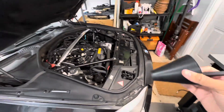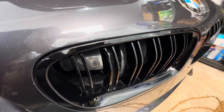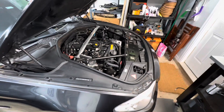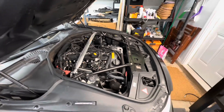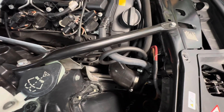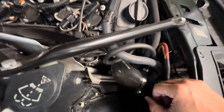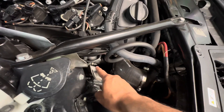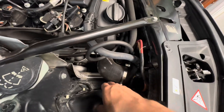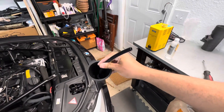However, it wouldn't be fair to show you guys that way because not everyone has a Bimmer House intake like I do. Something that we all have is a turbo inlet pipe, and that's located right below this elbow here, which is the last part of my current intake setup. Even if you have the factory turbo and the factory turbo inlet pipe, it's still going to be in this location. So I'm going to take off this elbow so we can seal it up and apply the smoke through here.